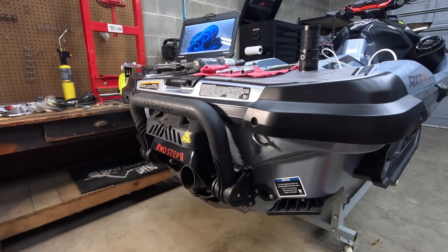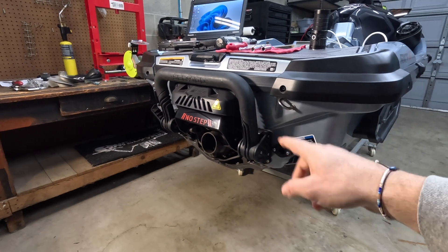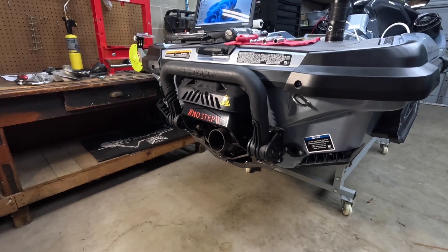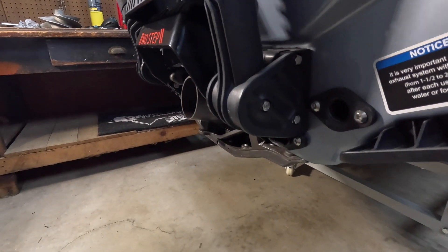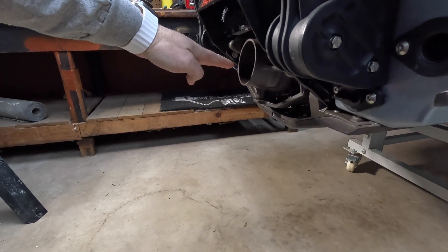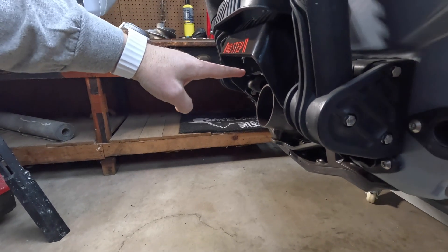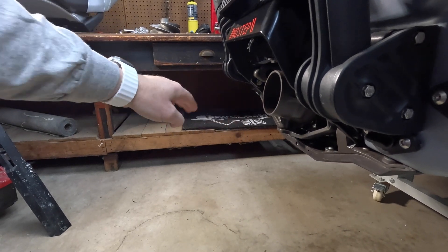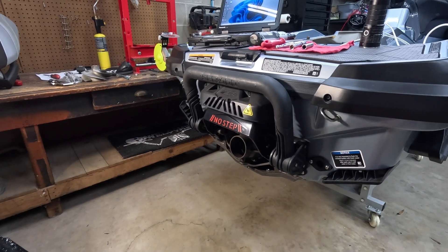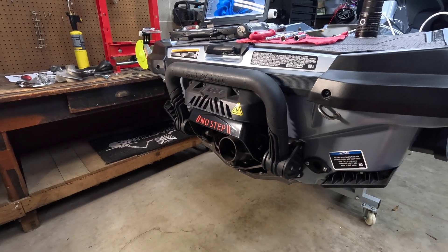For those of you that don't know, it was either 2022 or 2023 — the IBR stops came from the factory where they didn't allow enough VTS range. This is my ski here. You can kind of see from the side profile that now that I did the fix, the trim is more of an up angle. The bucket is higher. When I first bought the ski, this bucket was resting around here and the jet was almost straight out, so it wasn't trimming up as much as it could. I did this process and was able to gain four miles per hour — that's on the higher end. Most skis you'll gain about a mile or two.